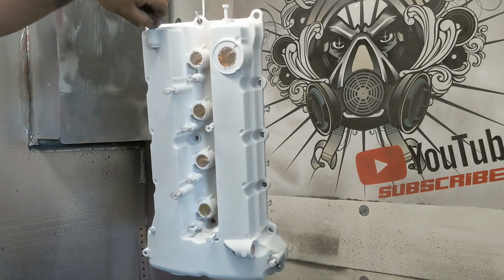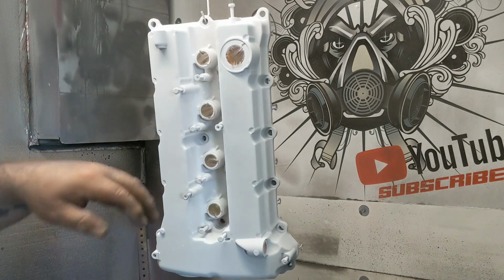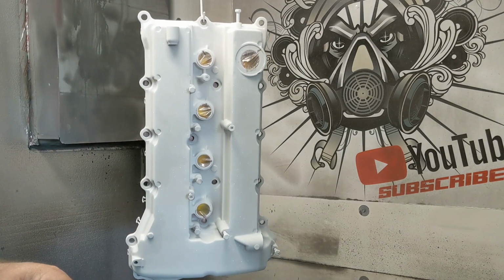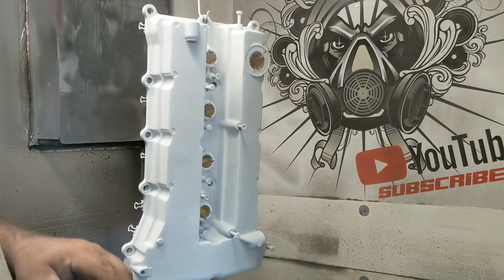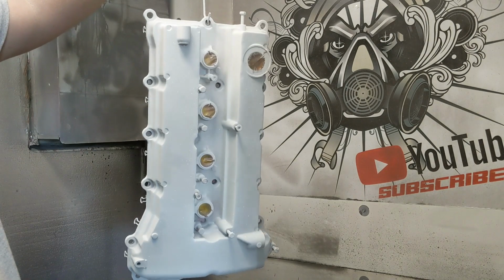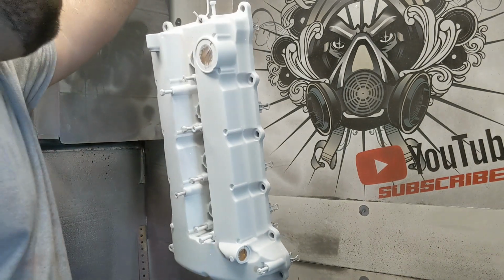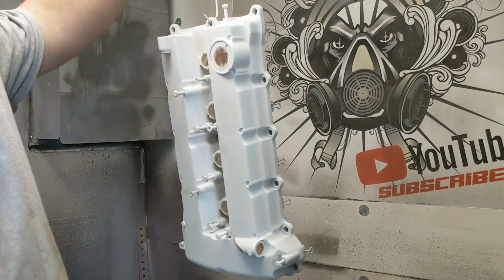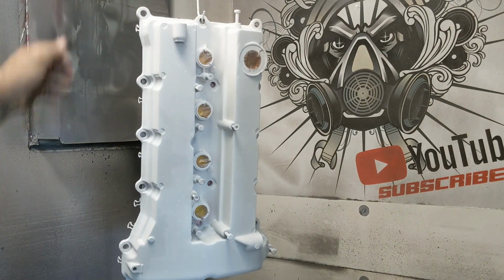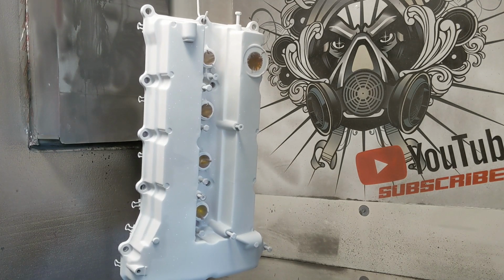If you have areas like that, I've seen people that have sprayed it while it's quite a bit warmer to help powders stick down into areas like that. I don't suggest it, especially on dormant candies, just because it can affect the color, the overall finish of the color. But if it's for your stuff and you're going to be content with whatever the color is, then it's probably okay too. The dog hair just landed on that. So we'll get this thing thrown in the oven, see what it looks like.